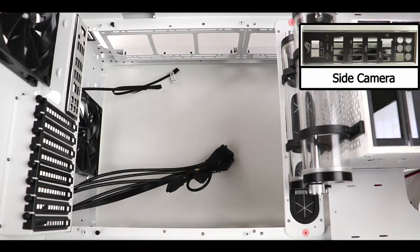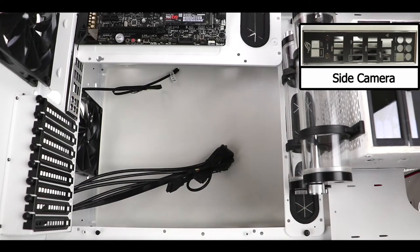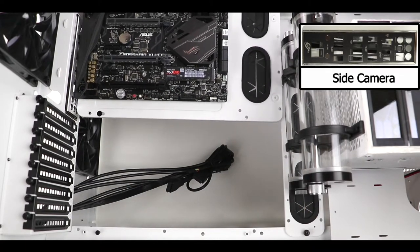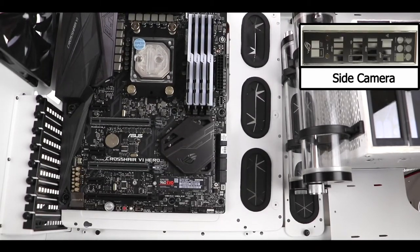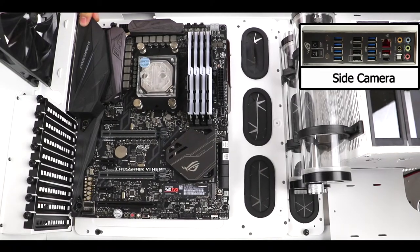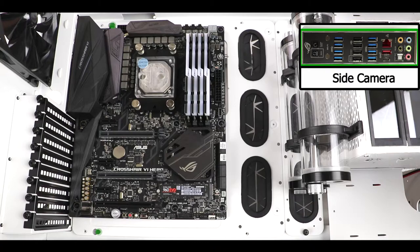The lower chassis plate is very easy to fit in, just make sure not to forget to secure it with its two thumb screws. Similar operation for our motherboard plate, simply slide it in gently and make sure that the peripherals perfectly match with the IO shield openings. Once they are aligned, you will need to slide the motherboard plate onto the two screws already placed onto the chassis. And finally, screw in the remaining four thumb screws to secure the plate onto the chassis.